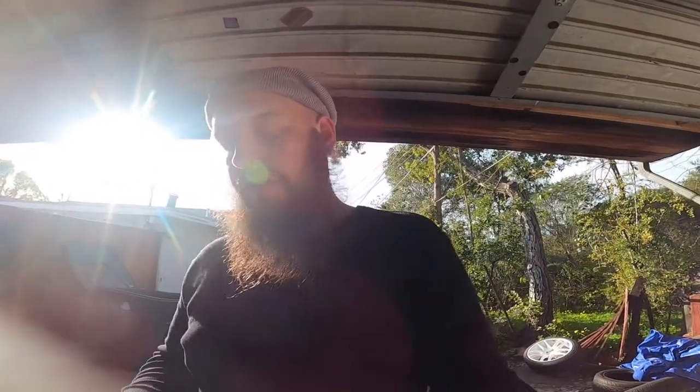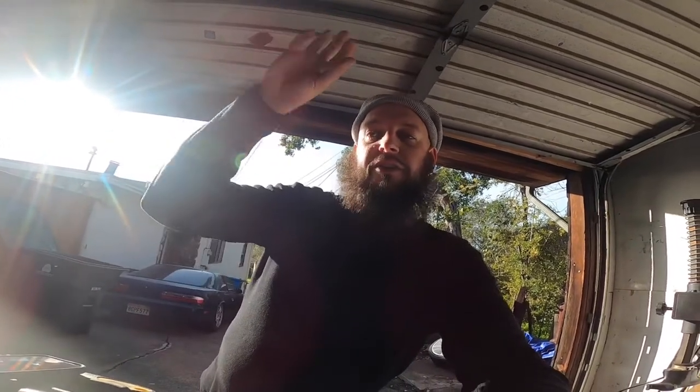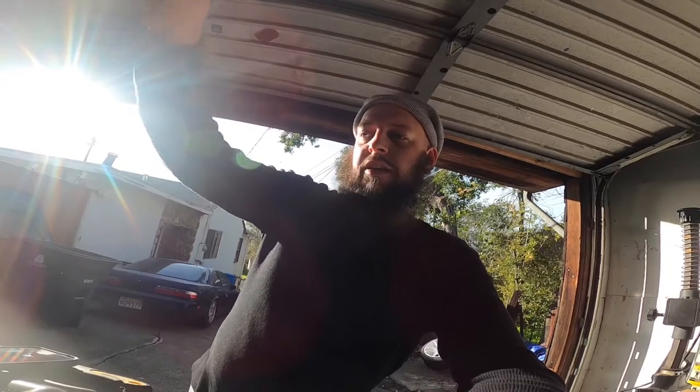That's pretty damn important - it's your oil delivery. I couldn't figure it out. I was watching a lot of people's YouTube videos and everyone's like, 'Oh yeah, you just put it on, put four bolts, put the gaskets,' but no one went over the routing. And I would have thought it went the other way just looking at it, because on the block adapter the left side is higher, so I'm thinking that's the feed - but it's not. That's the return. So definitely want to get that straight.